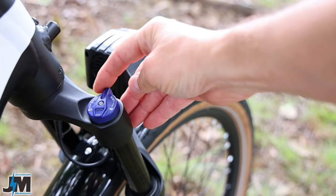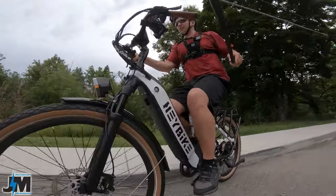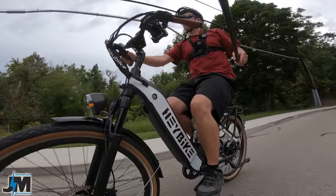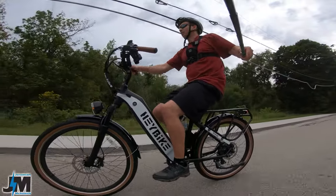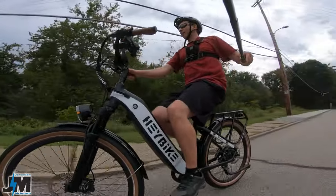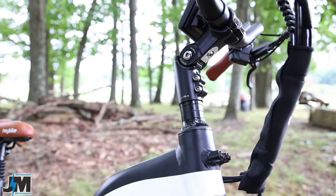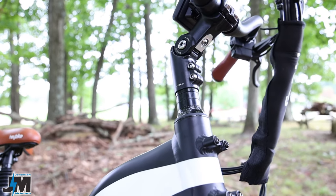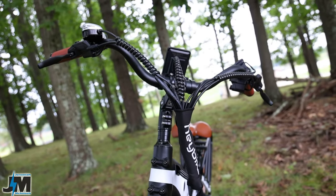Another upgrade on this bike is the hydraulic front suspension, which has adjustable compression via clicks on the right-hand side, and a preload adjuster on the left-hand side. It's a very soft and nice ride. With the suspension seat post on this sample model it's a shame they're not keeping it on production models. The overall seating position is mostly upright, and it has an adjustable gooseneck on the front that you can move up or down for reach. I love the mustache-style handlebars on this bike.